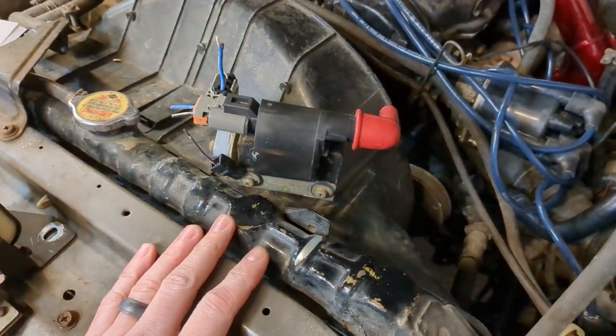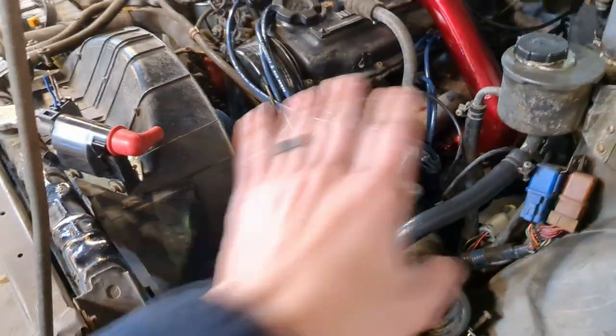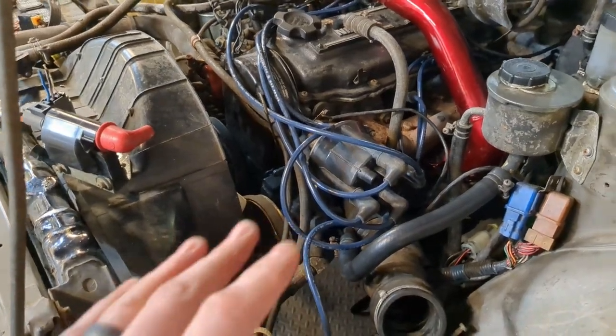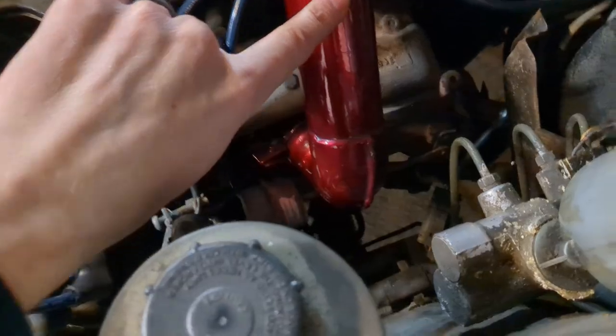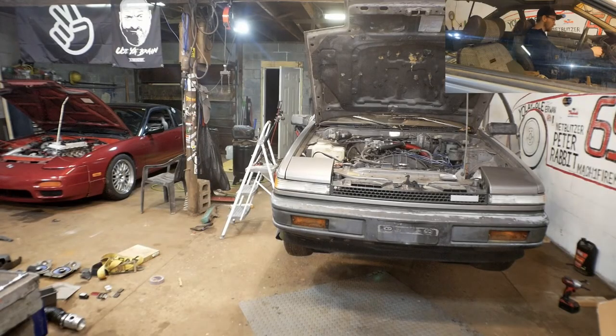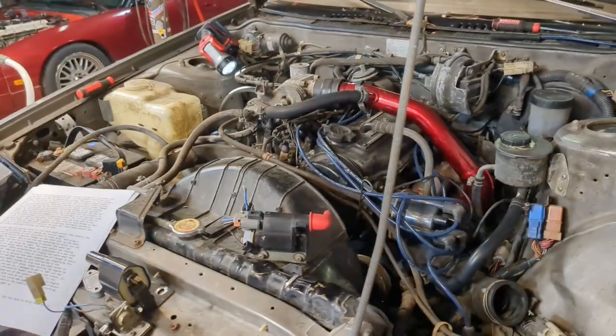So now, I'm going to put the exhaust side coil in here and get it together, mount that into the car, get the exhaust spark plugs changed, put those wires on, put it all back together. I'm going to cut this short and put an actual silicone seal on here instead of the factory grommet seal that is obviously gone. And then we're going to see if this thing's actually a good runner. But there you go. I probably missed something.